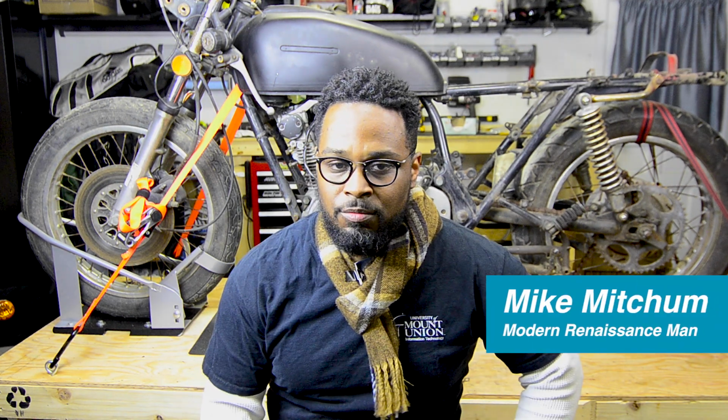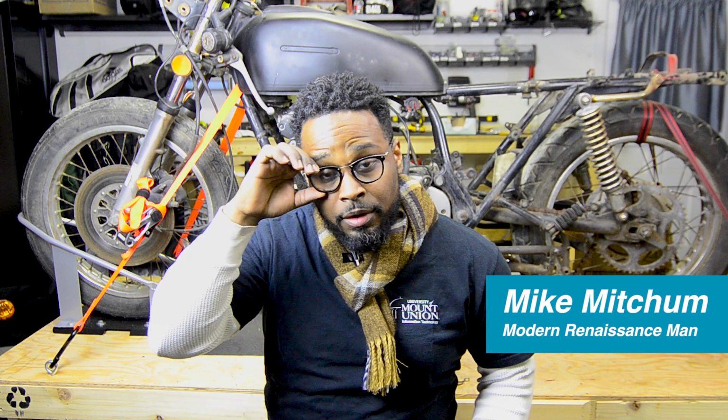Back in the garage again, working on the GS. After the last video, I did a little bit of research and found out that if you put a little oil in the cylinders after you take the plugs out, you can sometimes get the compression to come up just a little bit and give you a better reading, and sometimes that can tell you if air is leaking past the valves, all that kind of good stuff. So that's what I'm going to do.